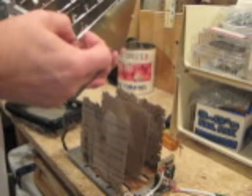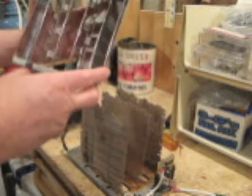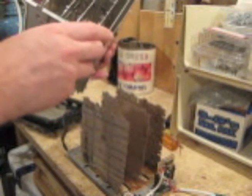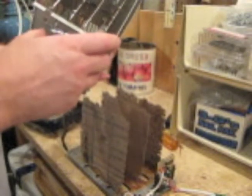What that does is it fits in these little slot and a hole right here, and when you press the lever down, it will move that trip bar, and it will trigger the electrical connection, make the electrical connection come together, and then the heating elements will come on.